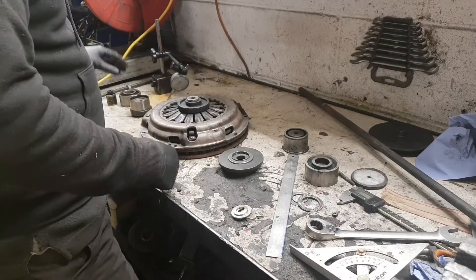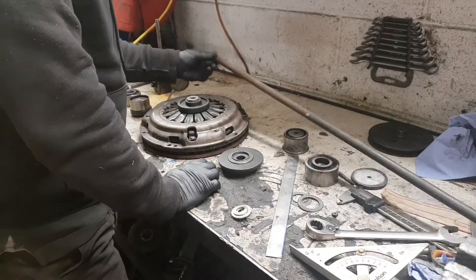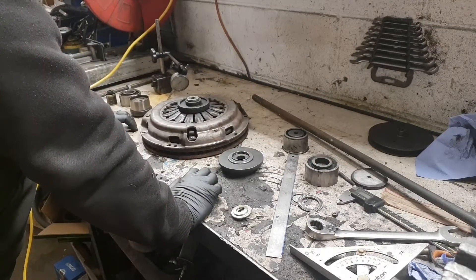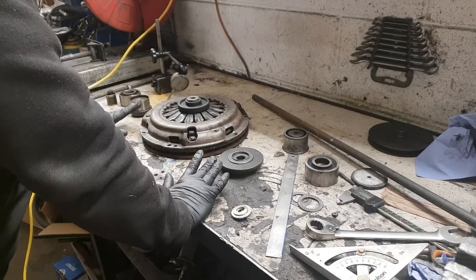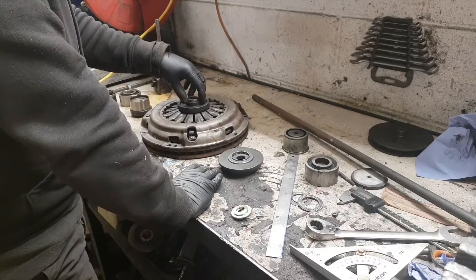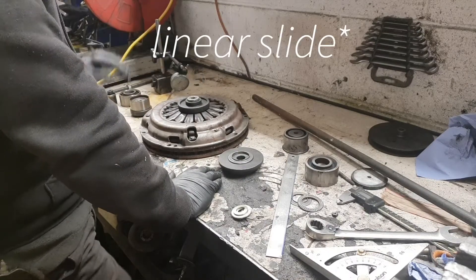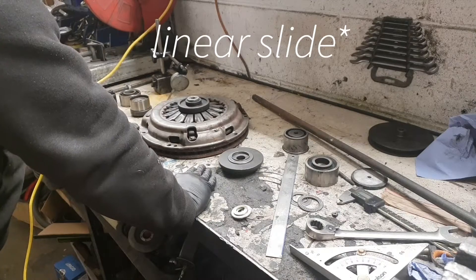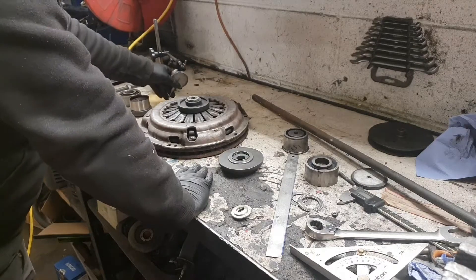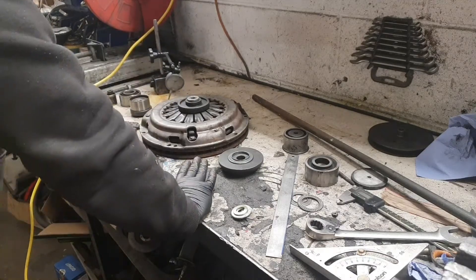This nut threaded onto the rod, and I'm going to make a load cell out of some of these too. I'm going to cut it off square in the lathe and apply a full bridge strain gauge to it, and then use an Arduino to read the signals from it. I've ordered a linear potentiometer as well — I didn't have it, it won't hurt to have a few extras, I've ordered 10. I was thinking about just using a DTI to measure the movement, but it would be nice if I could have both numbers logged in the software.